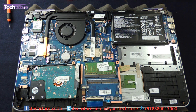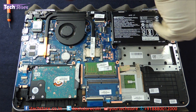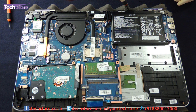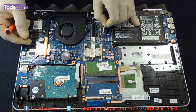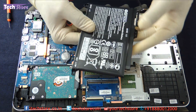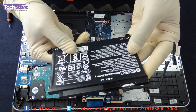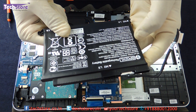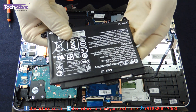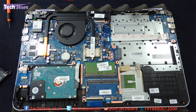First thing we need to do is remove the battery. Open these screws and remove the connector that is connecting to the battery. If you want to replace the battery, take another one — this is the BP02XL battery with ratings of 5150mAh, 8.8V and 7.7V, and 41Wh. This is a 2-cell lithium-ion battery, so just take another battery and replace it.